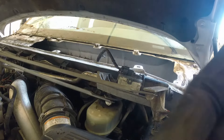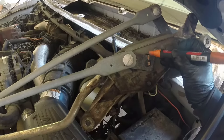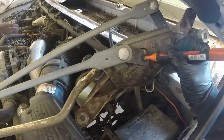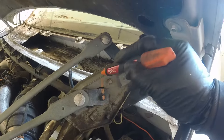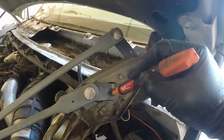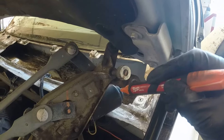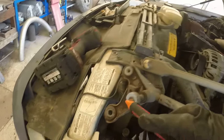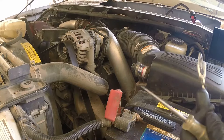I've undone all the bolts and as you can see there's the connector. I mark the position of the arm at the motor shaft and all those arms which are aligned to the mounting bracket — the same reference points will help me when I'm going to install the new motor. It just makes everything a little bit easier in case something moves.